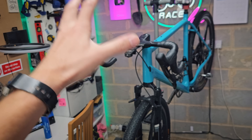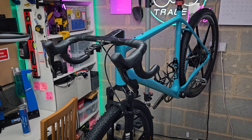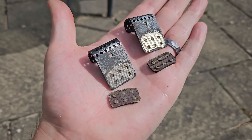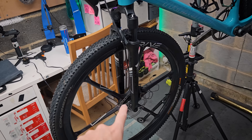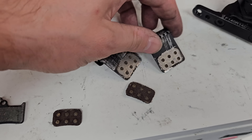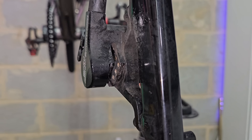One more thing worth mentioning: after a little bit of fishing for information on my part, it turns out Magine have also tested the QED groupset in the same way I did in the last episode. They took a set of brake pads and knocked all the pad material off on both sides down to the backing plate. From the evidence they showed me, after a normal brake bleed they were still able to brake fine. I've seen it, but unfortunately Magine won't allow me to share video of that test with you. From what they said, they don't want to be seen actively promoting that sort of use case because it is so far outside of normal parameters. Any groupset, regardless of manufacturer, should not be used in that way — it is obscenely dangerous. But I can report that, at least from what they've shown me, it does seem to pass that test.